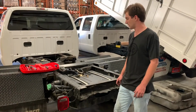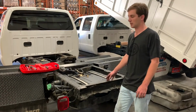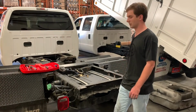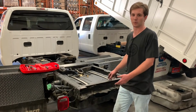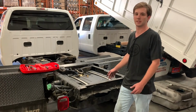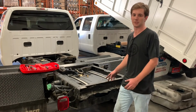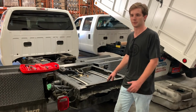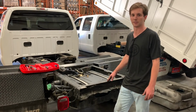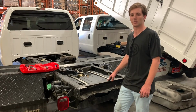So at this point, you're ready to start transferring fuel into your newly installed S&B tank. We don't recommend transferring fuel from the aluminum tank that you just took out because it could have delaminated, or probably did delaminate if you're ordering our tank. We also recommend looking into cleaning out your primary fuel filter and your fuel lines to be sure that you don't have any problems down the road from residual delamination material in your fuel lines, taking out an injector or something along those lines.